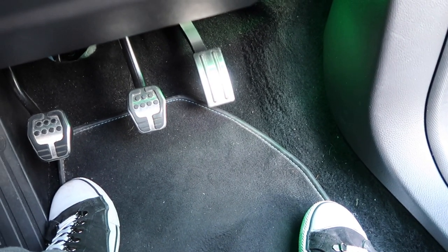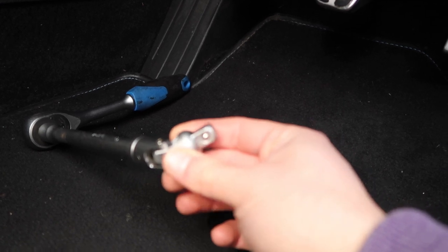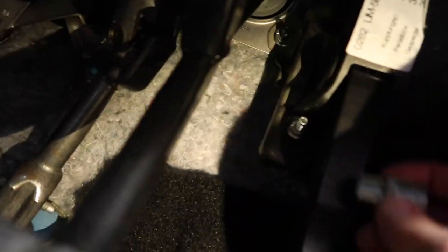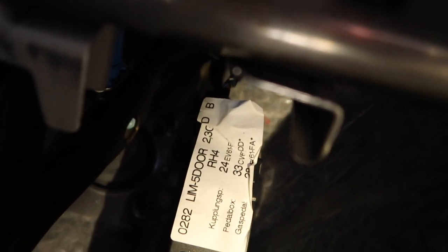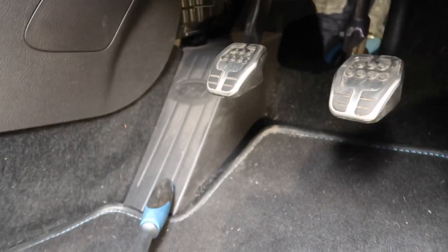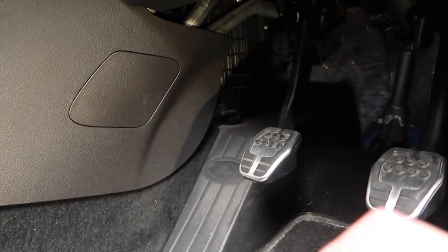To get our spacer installed, we need to use a ratchet extension — possibly another extension as well — and possibly one of these angled extensions to go around a bit of an angle, because it is a little difficult to get up in there. This is our pedal, and the connections are right up in there — you can see to the left that's one of them. They require a 10 mil socket. The other nut is just behind a bend near the label — a little bit more awkward to get to. Just those two nuts need to loosen the pedal. There is an electrical connection on the back, but I'm going to try and keep it connected, carefully position the spacer in, get the nuts back on, and tighten them up.